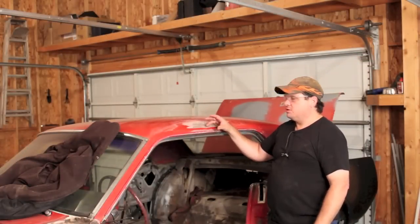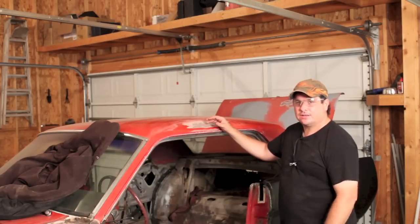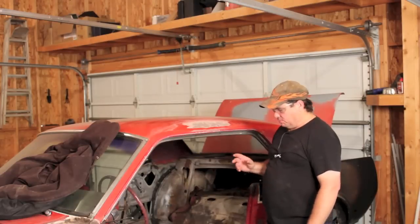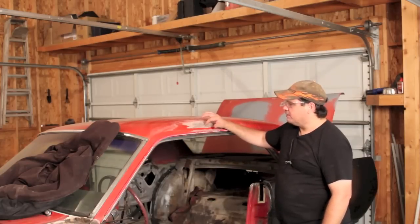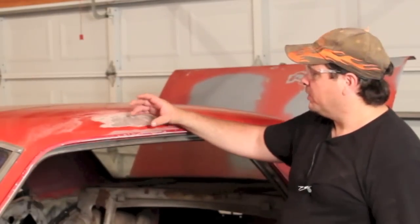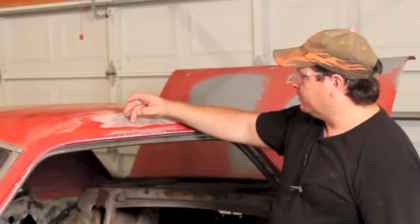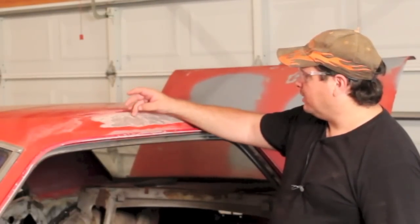I've got most of that paint removed. There's still a few spots - I can get that out later. My battery started dying. That is the disadvantage about using cordless drills like this as the batteries go down. I didn't have a full charge on it when I started. This is good enough to go ahead and get started. I'm going to go ahead and start putting some nails. I was talking about concentrating on these highs. On these dents, you don't want to go straight to the center and start working there. You kind of want to start on the outside edges and work towards the center. As you're doing that, you also want to concentrate on these highs - push down on the high areas as you're pulling out on the lows. I'm going to put some nails on this outside ring of this dent and we're going to raise that up and then work towards the center.